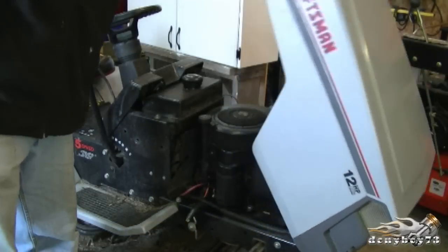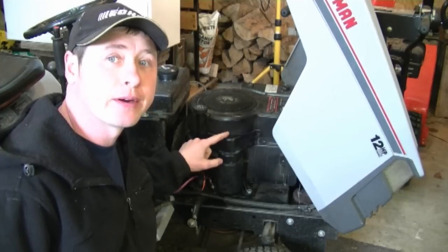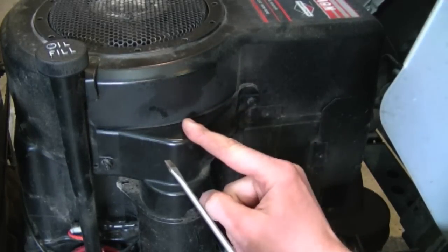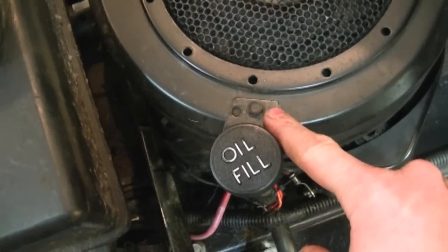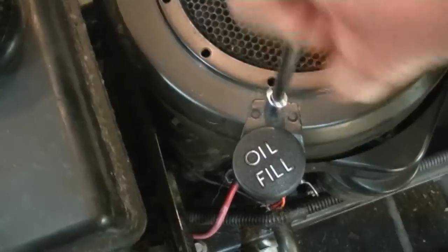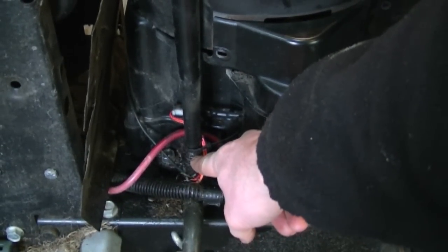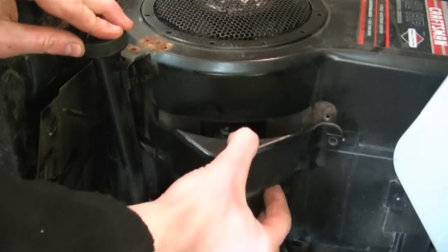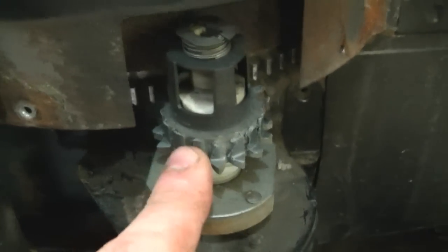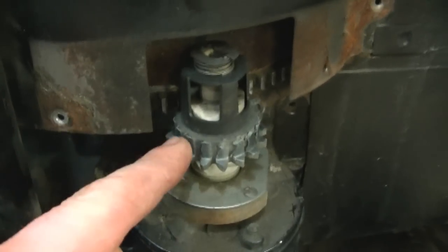First of all, pop the hood open. If you've already guessed that it's a starter issue, you're right. What we're going to be doing is repairing the starter gear on the starter. We're going to start by removing the two screws that hold the plastic cover over the starter gear. I'm also going to have to remove this 5/16ths bolt here that holds the oil filler tube. Do not remove the oil filler tube from the crankcase or else there could be oil spilling out. Now move the tube aside a bit, grab this plastic cover — it's going to come off. And here's what the problem is: as you can see the gear is all stripped. It's made of a plastic or nylon. This is what the new gear is supposed to look like, so you can see why it's not grabbing at all to start the engine.